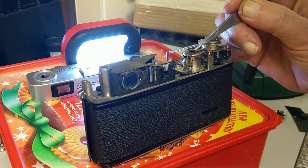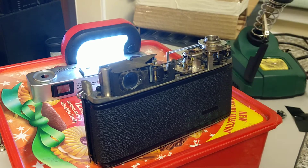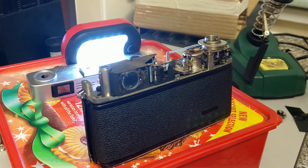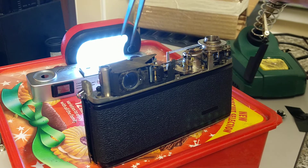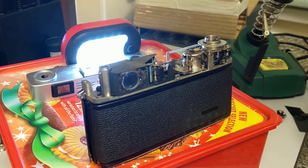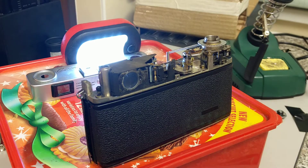You can even see this wire is green at this end as well, so that wire needs to be replaced. We'll put the camera back together while we clean it up. We can recalibrate the rangefinder if it's out, and I'm presuming with this potentiometer on the top we can also adjust the exposure meter so it's reading the correct exposure. So in part two we will put it back together, change that wire, and hopefully have a working meter in a working camera.